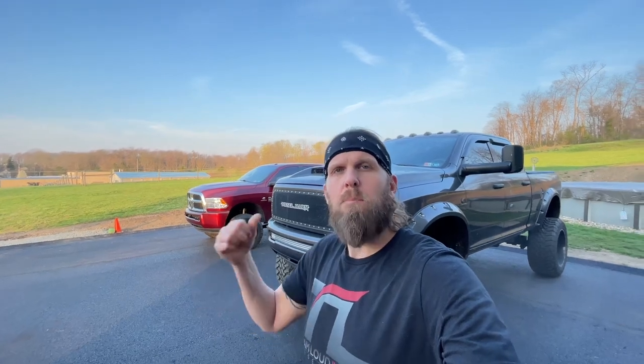Welcome back to the channel. Today we're cleaning up the truck and painting the axles. I'm not going to go as far as having the wheels taken off and axles sent out for powder coating. We're going to wash the truck, get everything dried off, wipe the axles with mineral spirits, tape everything up, spray with black automotive spray paint, and finish with a clear coat to shine them up.